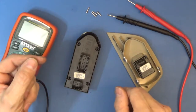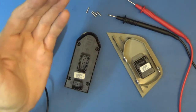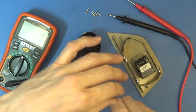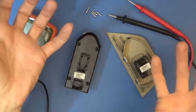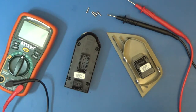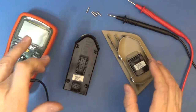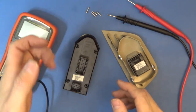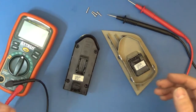When you listen to it, you don't hear anything inside the door — there's nothing wrong with the regulator inside there. The regulator is just the slide track for bringing the window up and down, not a voltage regulator. That part is about $300 on Amazon, and if you hear grinding inside, that's probably the problem. I do not hear any grinding. When you try to go up, nothing — no click, no dimming of lights to signify a load on the system.